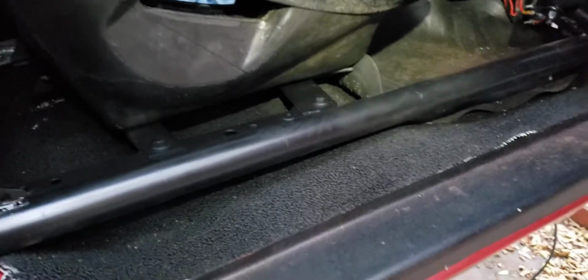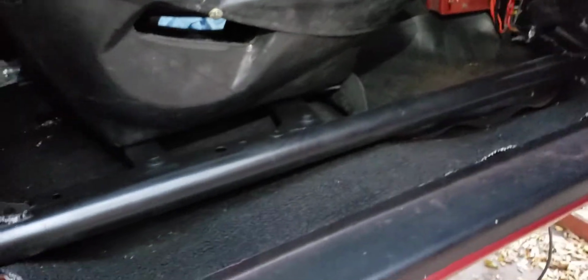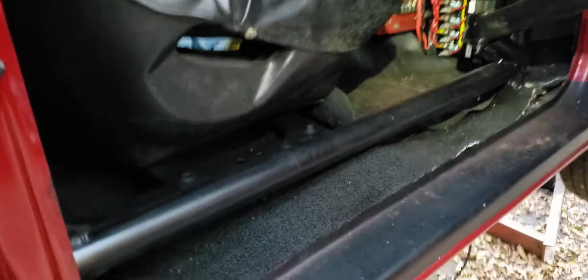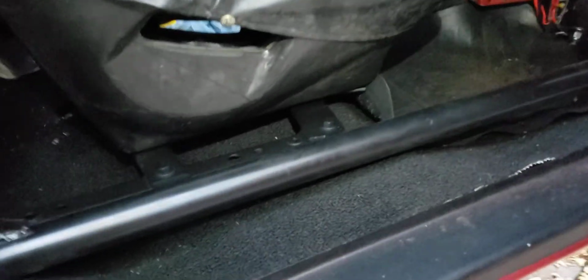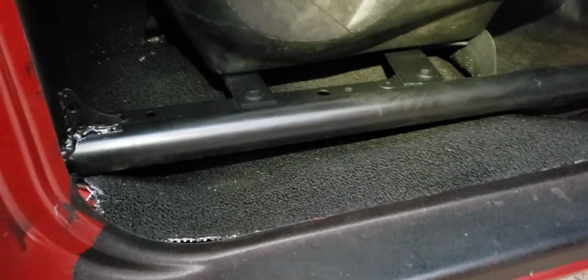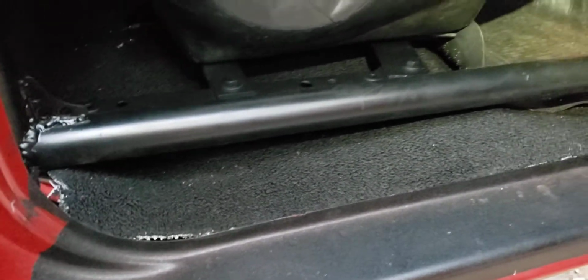Made a bracket for it, and when I make a bracket for these trucks, because there's not like a square 6-inch spot on these floors that is flat, I cut the brackets off the original seats and use them as the rails, and then bolt or weld in cross pieces for the seat to actually mount to. Pretty easy and way less expensive than the ones you buy.